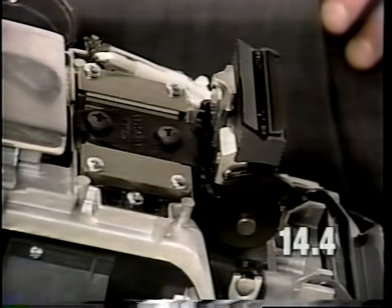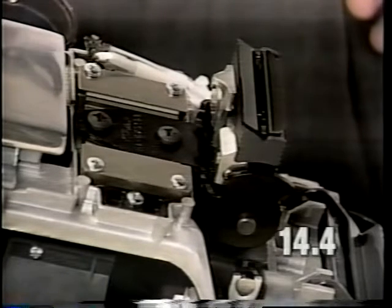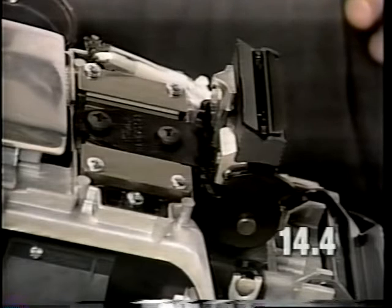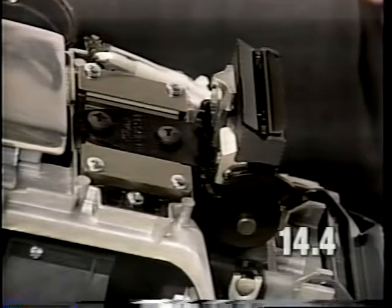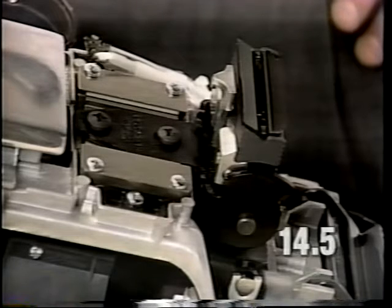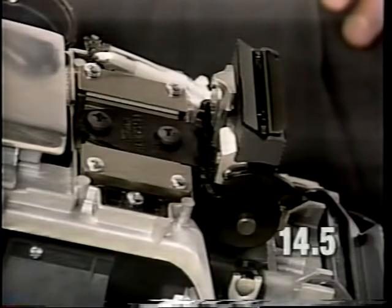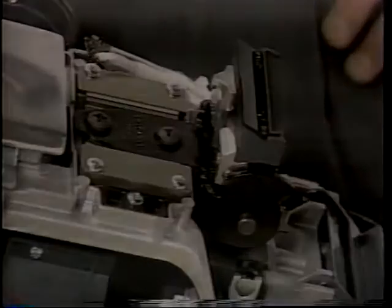On a Generation 3, the tilt latch may be rubbing on the scuff plate. This will cause the machine to either stick in forward or reverse due to the interference. Correct the interference. Also, on a G4 or Generation 3, if the inside of the cloth bag is dirty, you should vacuum it out. The pores being trapped full of dirt in a cloth bag will affect the transmission performance.